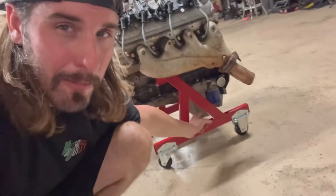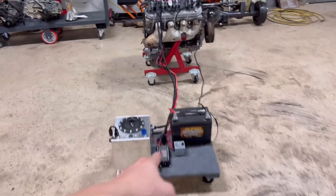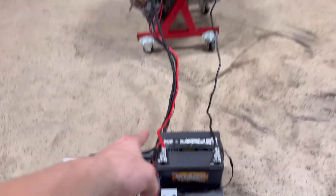I can also test my own motors — like I'll be able to build that 6.2 and run it before I put it in the truck, and I'll know it's making oil pressure and making compression. So if it doesn't start when it's in the truck, I know I did something wrong wiring or hooking something up. Back to this oil pressure gauge — that thing don't move when we fire this up, we got issues. All right y'all, let's try to crank this thing up — enough playing around.